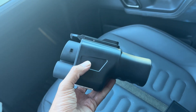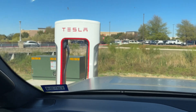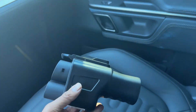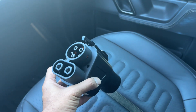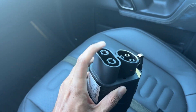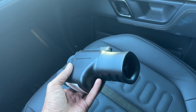Another important thing to point out — a lot of people still get this confused. This is strictly for DC fast charging at these Supercharger units. This is not for use on the Tesla destination chargers that you'd find at a hotel, or the Tesla chargers that you have at home. You need a different type of adapter for that, one that doesn't include these two pins down here, and of course that's for a lot less current.